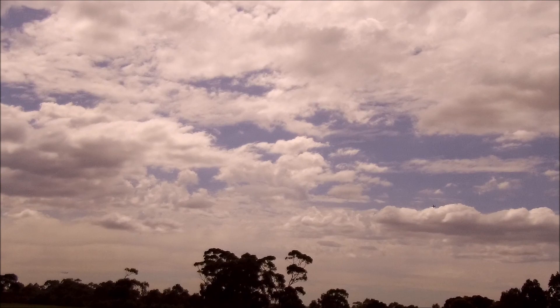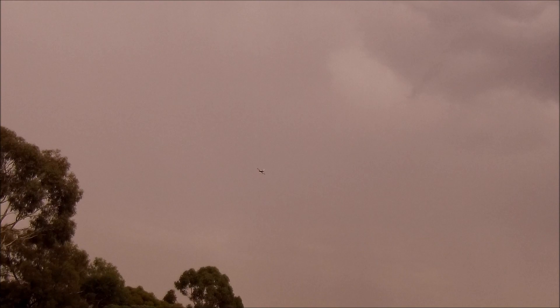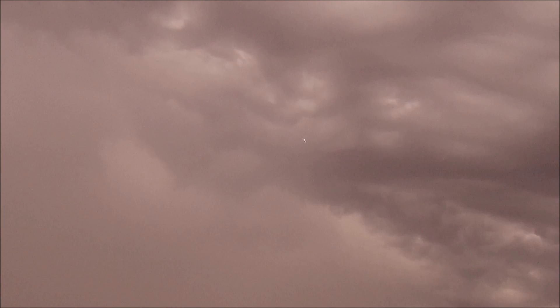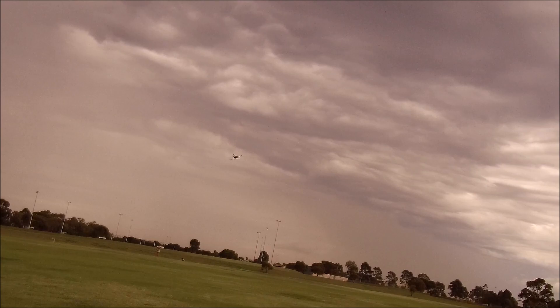I've been flying around using a lot of power — roughly 60 amps, pretty brisk. You can really fly about 50–55 quite sportily. That's getting close and I can smell it more and more — I think I'm going to have to pack up after this flight really. Telemetry: 21.4 volts, 53 amps, 2507 milliamp hours. 20.7 volts, 87 amps, 2725 milliamp hours.